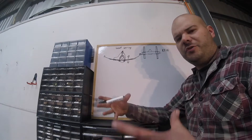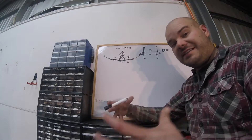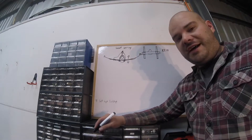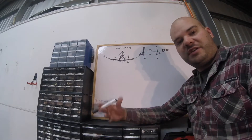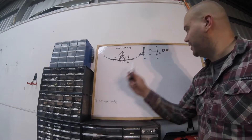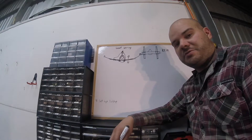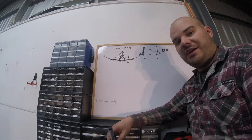Our little van was a panel van, designed to be used as a work vehicle, designed to have heavy things put in the back. So even though Toyota were not using leaf springs in all their cars of this era, with the panel van they decided to because they wanted to carry a bit more weight. It's really good at weight load, but it's not so good for movement of the diff — as the diff wants to move around it's literally bolted to the leaf spring. A lot of older cars still run a leaf spring because it was the engineering of the time and probably a cheaper way to manufacture. My little K15 actually has leaf springs still, so we could go have a look and I can show you exactly what a leaf spring looks like on our race car.